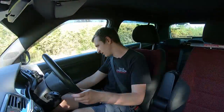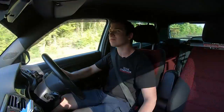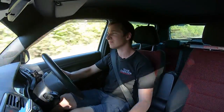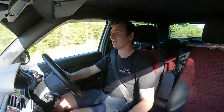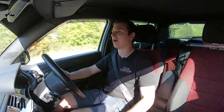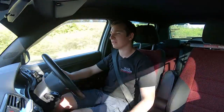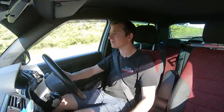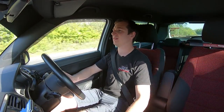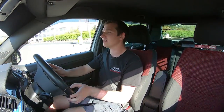Really happy with that. Let's see, where's the meth switch go? We're on while we're doing that. Yeah, big difference in smoke output with the methanol right at the top of the revs. Not too bad in the mid-range, so you definitely feel the extra torque with the meth on. Just punch it now. Still pretty good. But yeah, noticeable difference with the meth. Obviously, if you're not screaming it round every time, you're probably not going to use a lot of it.